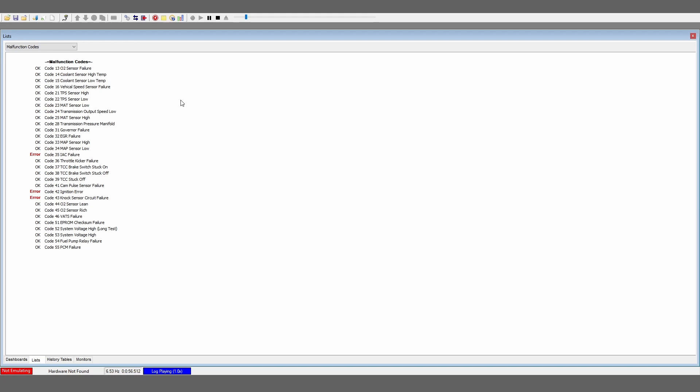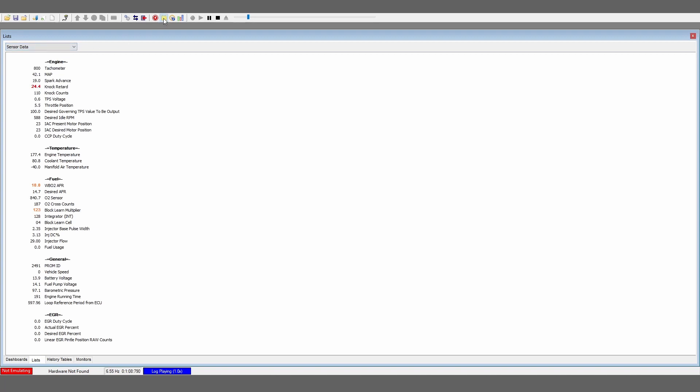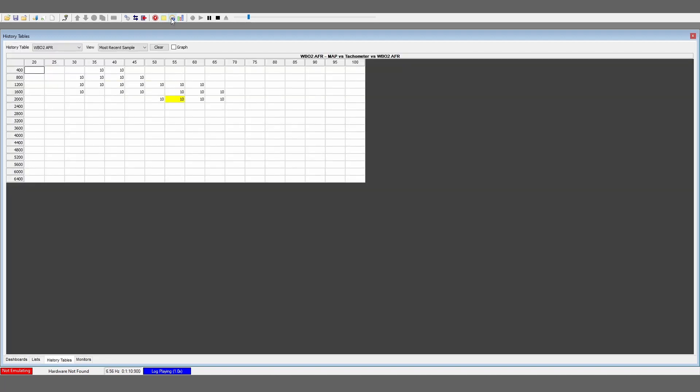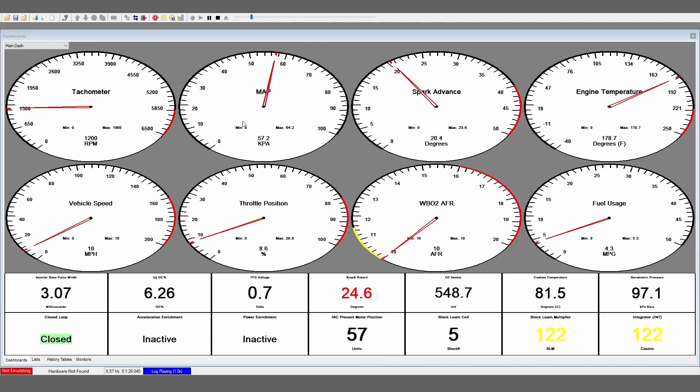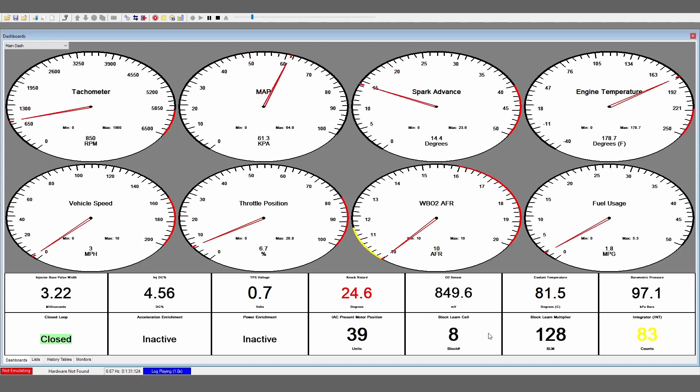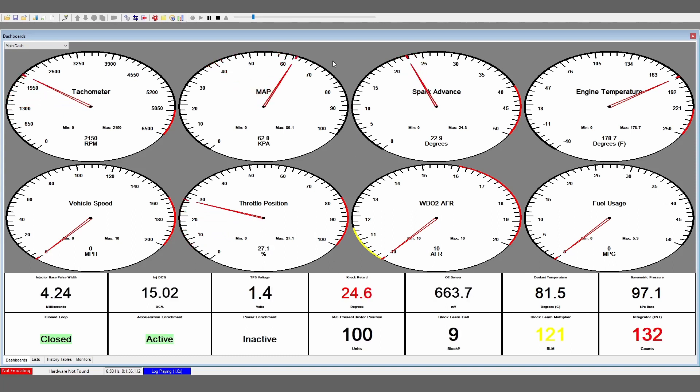This thing will tell you everything you need. Here are the malfunction codes, and if you look in that book, it goes into more detail on what these codes mean. Having that book, the internet, and Tuner Pro RT — if you can't figure out the problem, I don't know what to tell you. This helped me realize that I had a knock sensor issue. I gotta go chase the wire to fix this. You can actually change these gauges, swap them around, flip them around, replace them with others. Fuel usage is pretty cool. I don't know anything about block learn multiplier or block learn cell, but you can change these around as well. I just swapped the AC out.